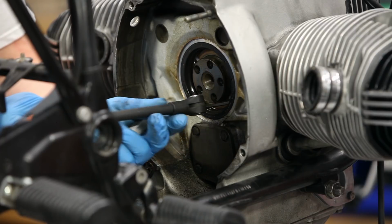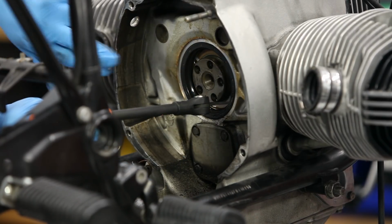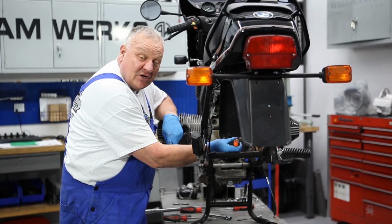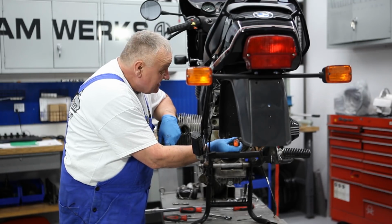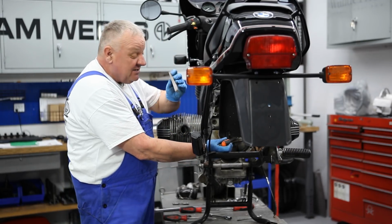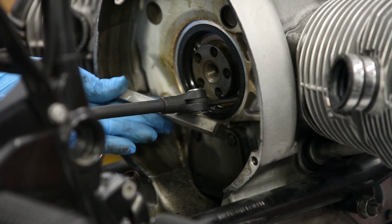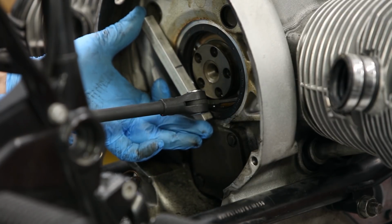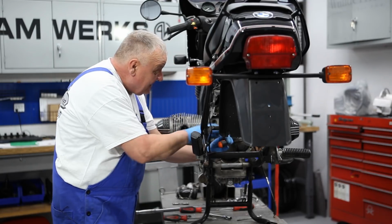You need to go in and grab a hold of that seal by pushing that in. Now, you don't want to press or pry against the crankshaft because that could dislodge it, possibly. It's just not a good idea to do that. You need something else to pry against. So I use this piece of aluminum, a little 1/2-inch bar that I can just lay in here across. Anything would work, a piece of wood, really anything you might have laying around.